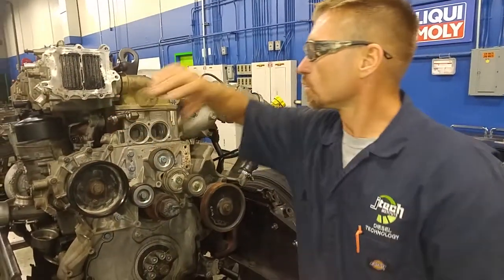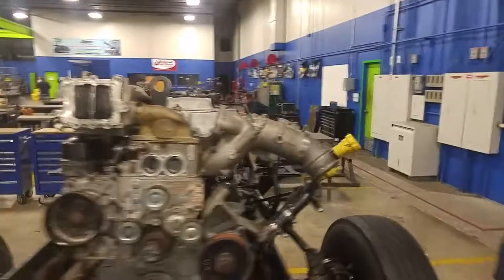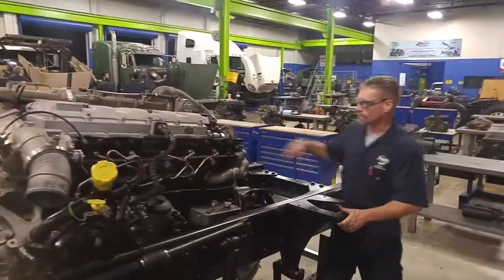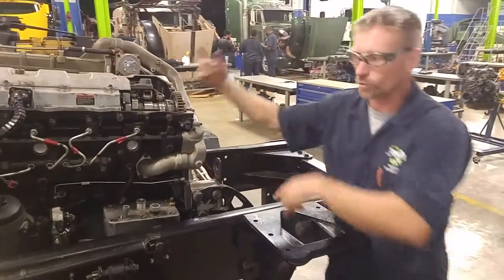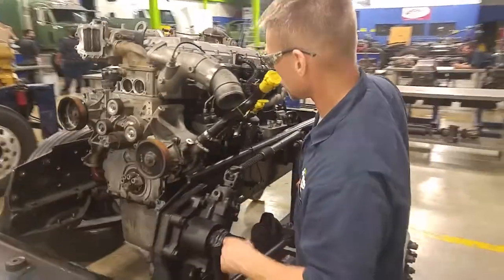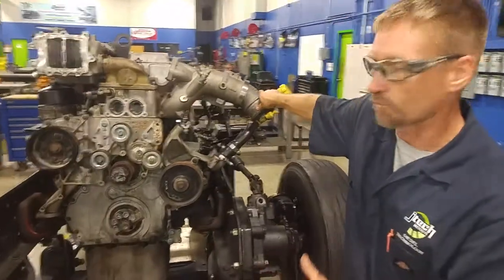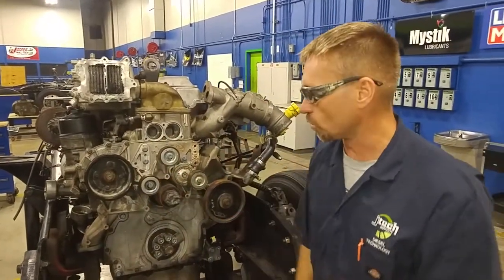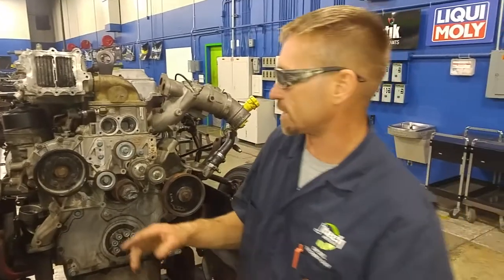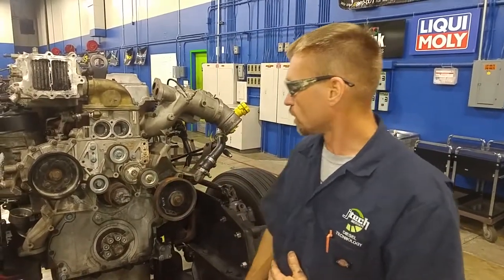Also through the manifold, the flow is divided and directed up into the bypass and into the EGR system, shoots in the back, and back out of the EGR system right here, continuing the loop. A large fan will sit right here with the radiator right in front of it, maintaining temperature, and the serpentine belt drives the water pump right there. It's important to maintain a good belt — check it regularly and make sure it's serviceable so you're not overheating your engine. I hope that gave you an overview of the coolant and EGR system on this International. Thank you very much.